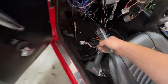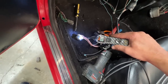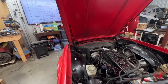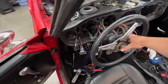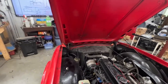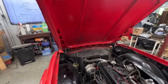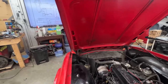We have power here to the ignition switch — 12.3 volts. We also have power to the lights, because look — if I pull the stalk towards me, there you go, you can see the headlights coming on. One click gives us the marker lights. If we turn completely on, now we have headlights, and if I push the dimmer switch — there you go, we have high beam and low beam.